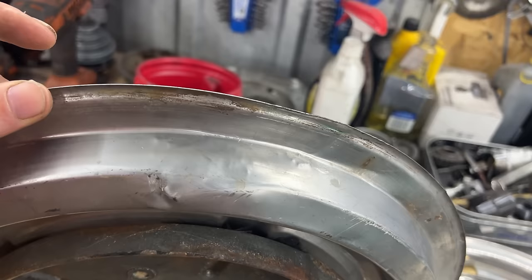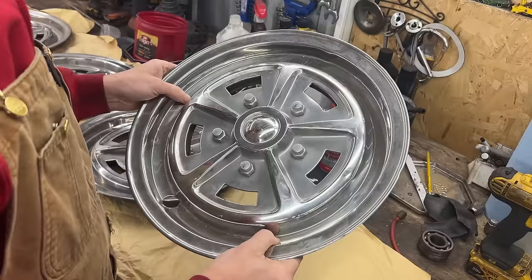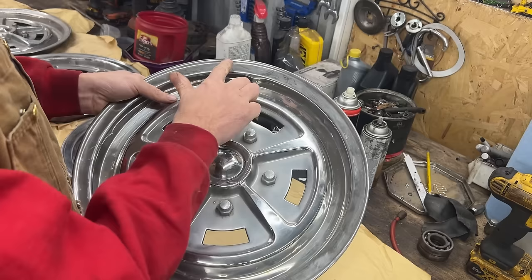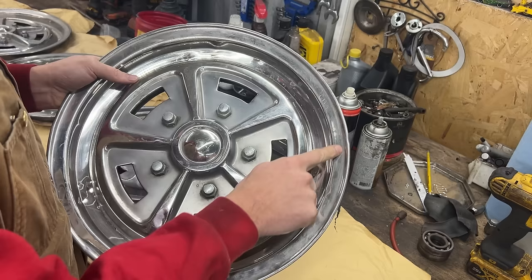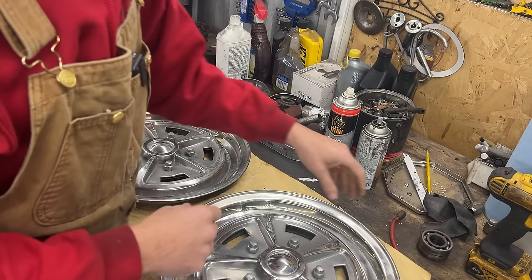So let me put you on the tripod and I'll show you more. I have a few ideas about how to fix the dents. My first idea, for easy to access parts, like for example this surface here, is to do it on an English wheel. In the past I had pretty good success flattening dented surfaces with a flat wheel on the bottom.